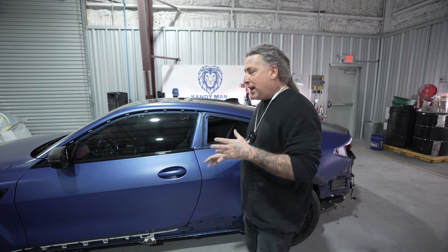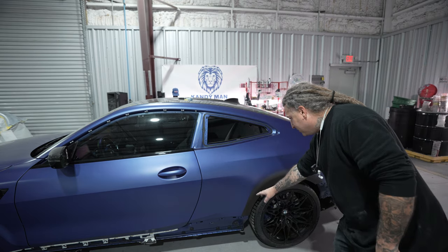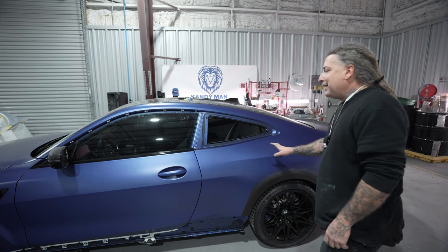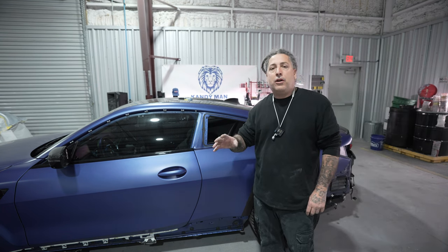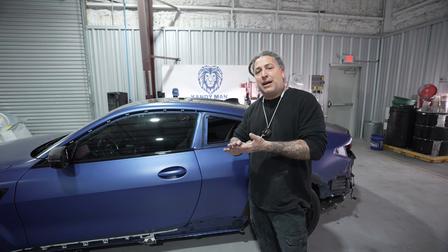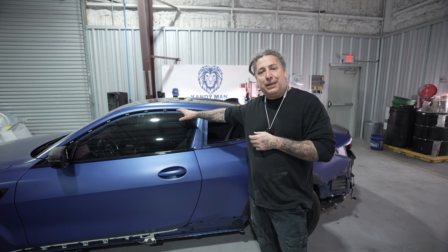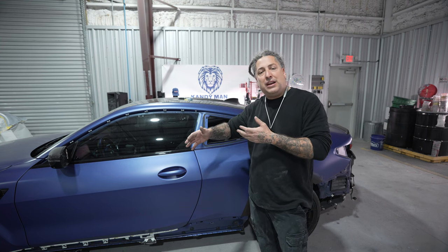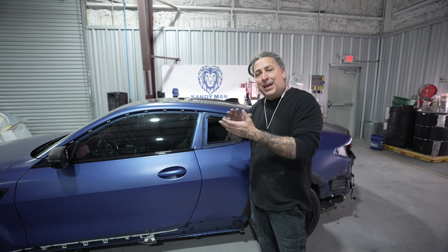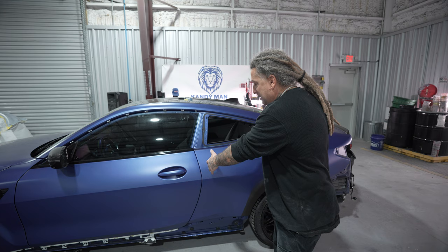So we do have limited area here. You guys see the damages around the wheelhouse. So when I'm doing this one, I'm not gonna seal this job. All the parts were repaired, so I don't have to worry about adhesion to the E-coat. So we could rely on the mechanical scratch, and we're gonna prep this one out with a 600 grit, very fine, do our areas in the 800 with our blends. That way we can move straight into the base and keep the color nice and smooth and not have to worry about getting it too far on this blend panel.